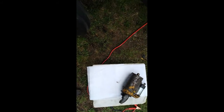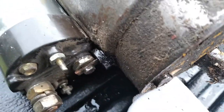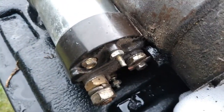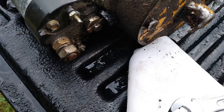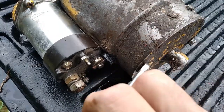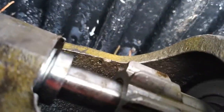I'm gonna pull it apart now and check the brushes and bearings inside. Somebody's rounded off one of the brush plate bolts — starter bolts there. It's supposed to be three-eighths. This one's loose, this one's mangled.